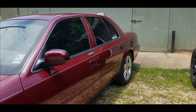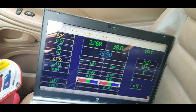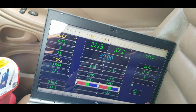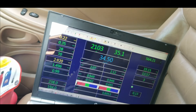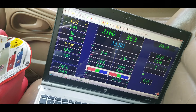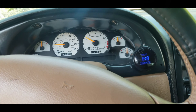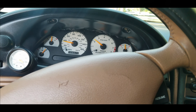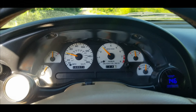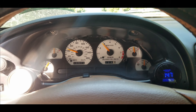We're going to continue doing all the work and get this supercharger on here. Right now I'm doing some logs — not only logging idle, but also logging for the mass airflow tables, checking everything, doing finalizations on this program, and finding a few hardware errors. We've got a slight misfire at low idle that may be a spark plug wire. We're on a higher content E85 again because the pump content is changing, and I'll have two different tunes for that.